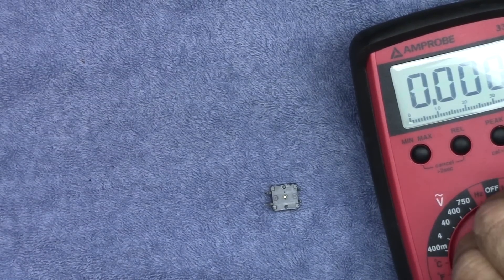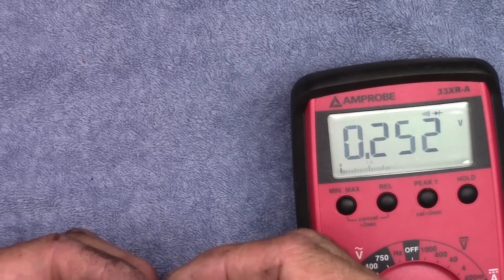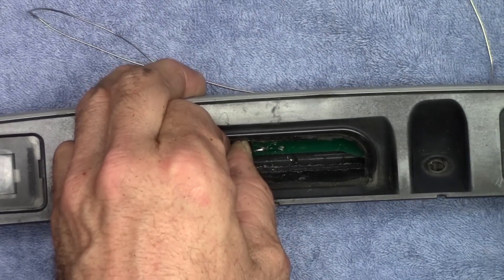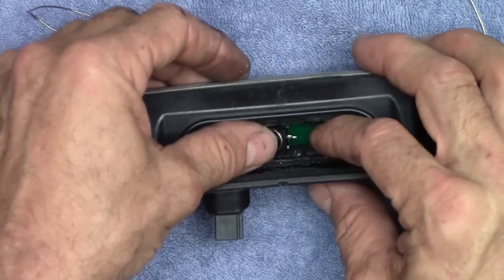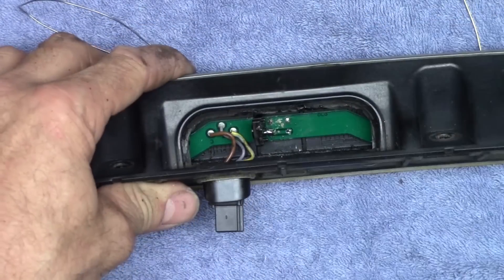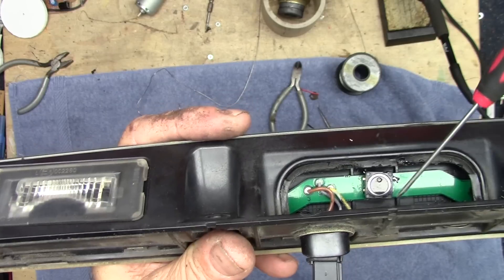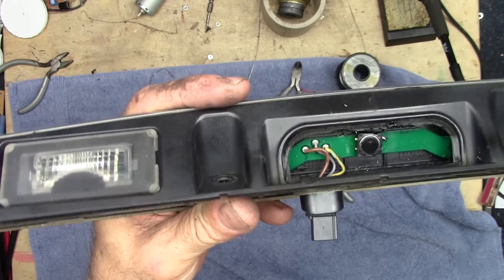So first I've got to figure out which way the current flows through this thing. Get just one side soldered in place. With the help of a little jumper wire, I got that big switch in there. I soldered it at that corner and then from up here at the top, I ran a wire diagonal across that way to the other terminal, soldered it up. Let's go test it.